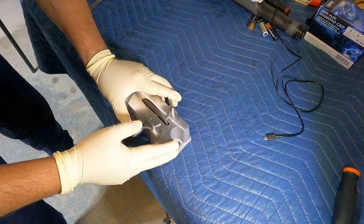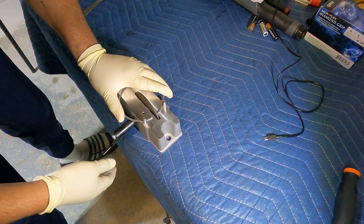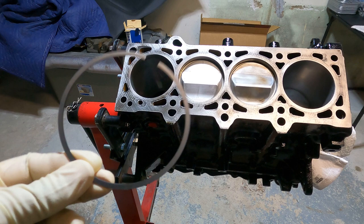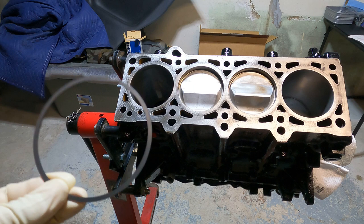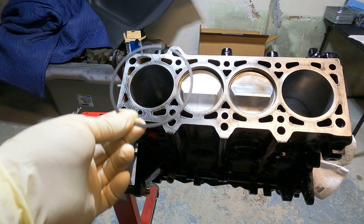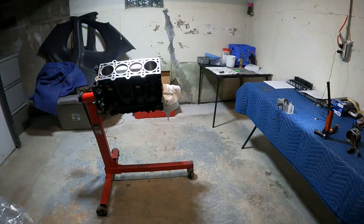Keep the ring pushed up against the file, keep some pressure there, and just start filing down. Make sure it's nice and tight. You'll be going back and forth multiple times doing the top ring and the second ring. You don't really need to gap the oil rings, but you can if you'd like. I'm going to put this on time lapse now — just gap, check, gap, check, gap, check — and then once they're all gapped and ready to go I'll show you how to put the piston in.